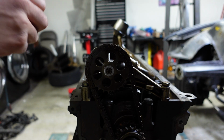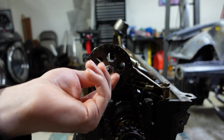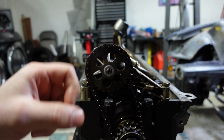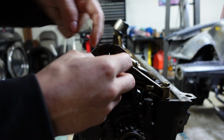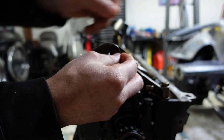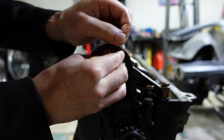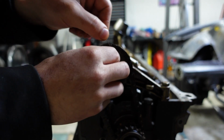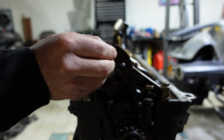So now we'll do the safety wire. Since the nut is spinning counterclockwise to tighten it, it's going to loosen clockwise. So we want to prevent it from loosening. We're going to want the wire going this way here, just to keep it from wanting to undo itself. So first, just run the safety wire through the nut. You can use safety wire pliers. That's kind of what you're supposed to use. I forgot to pick some up, so we'll just be using standard pliers, and hopefully that'll be adequate enough.